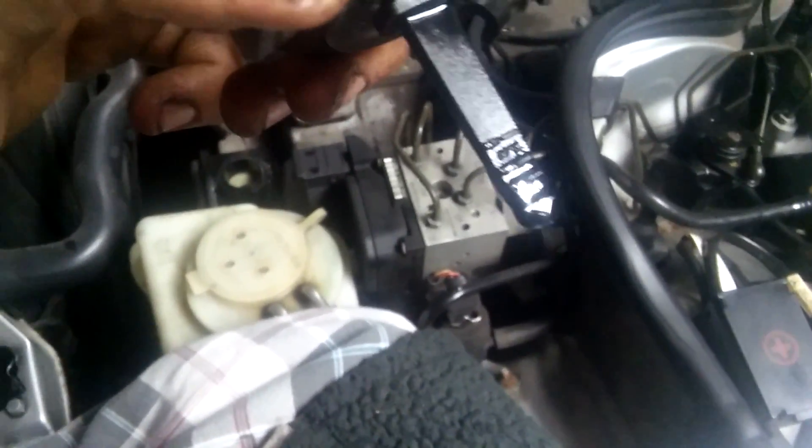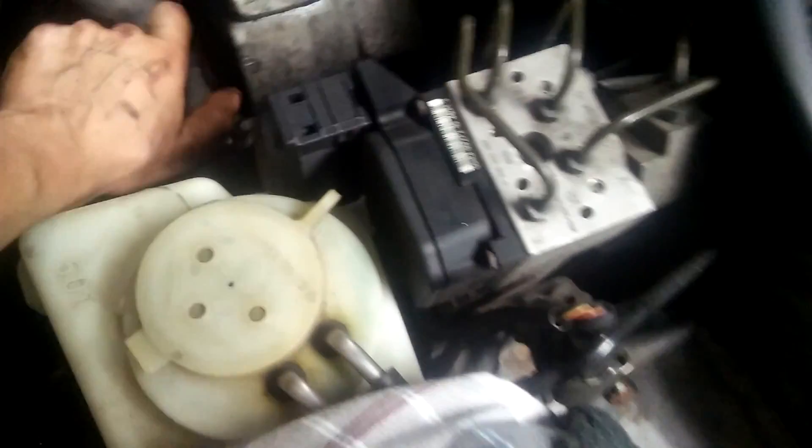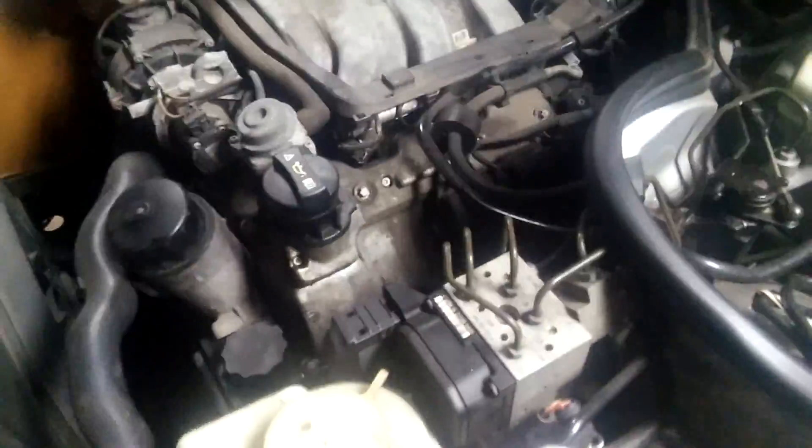The engine is at operating temperature, so the level is at the minimum and we can add more. Add more fluid, make sure there are no leaks, and spray some brake cleaner over any spills. It's a pretty easy job. The system takes roughly a quart of power steering fluid. That's how you flush the power steering fluid — thanks for watching, hope this is helpful, and do it at your own risk. Good luck!